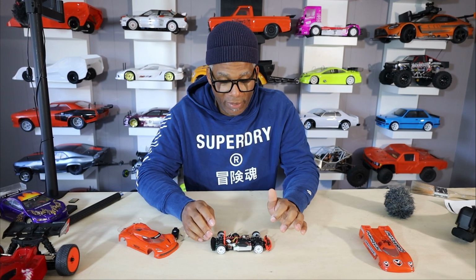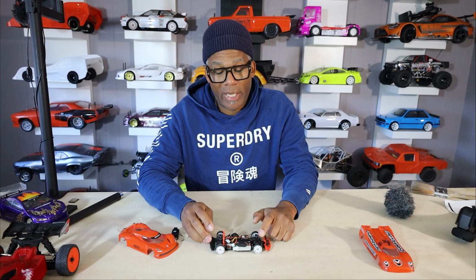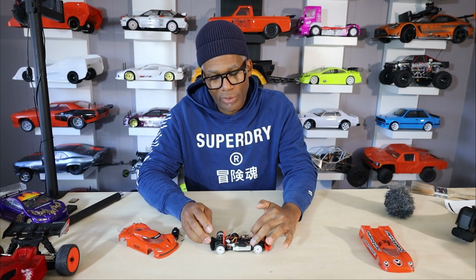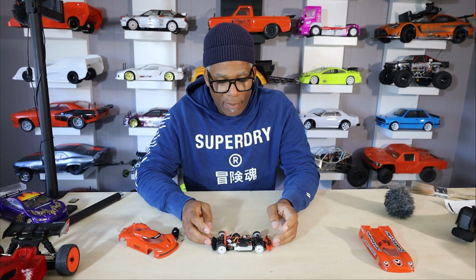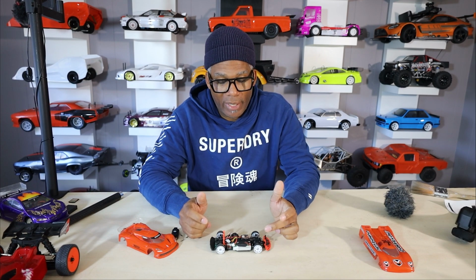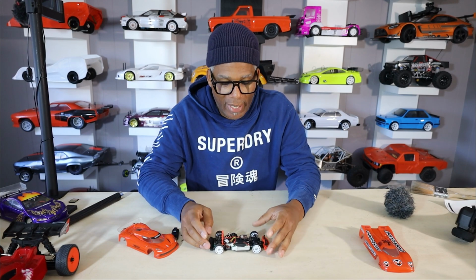I've seen people break the front steering knuckle because the arm on it, on the plastic one and the aluminum one, is very long. That goes from the front axle to where the steering turnbuckles meet the car. I never broke any of the plastics, but on any part where you have to change anything in the front end, when you're taking screws in and out of that part, you should replace it with aluminum right off the rip. Not because of durability, just because you're going to wear out plastics taking the ball on and off, like when trying to change things in the front of the car, add shims, stuff like that.